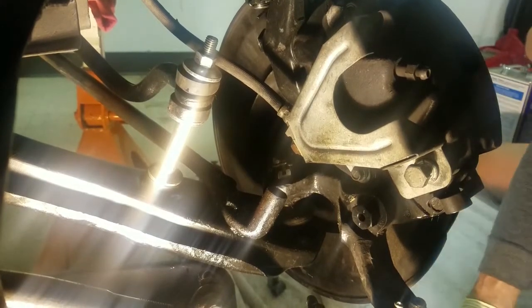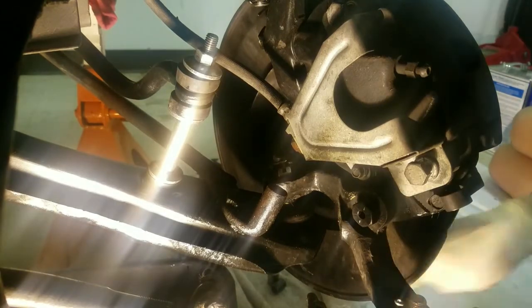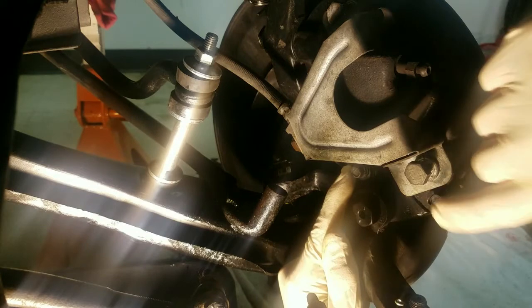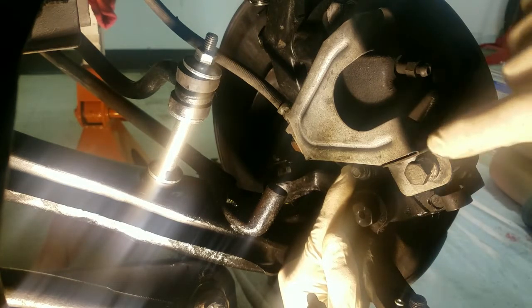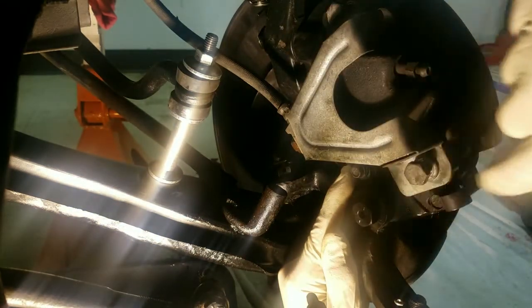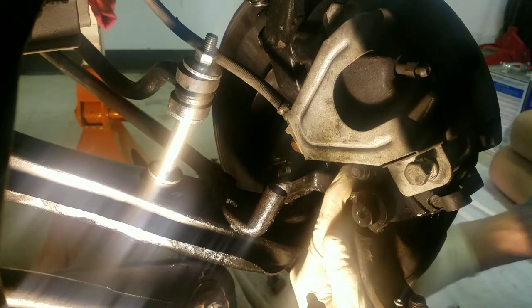Okay, I hope you can see that. Well, I've got my selfie stick back there, which the Rolls-Royce guys are probably pretty used to. By the way, what we're looking at here is I'm going to take this off, which is a spring that actually holds a brake pad in place. There's two screws, one here and here, and these are a brake centering deal. They go through a rubber grommet. These just hold this back plate on, and there's one on each side. And then this bottom bolt here, that holds the brake line on. And as you can see, I loosened it.